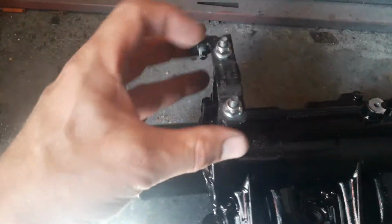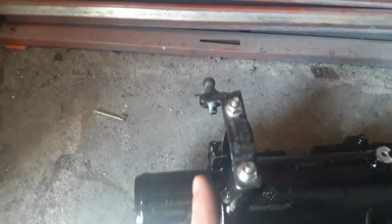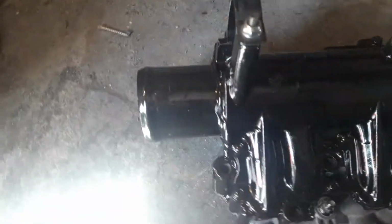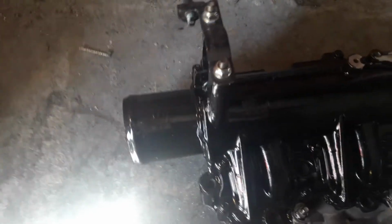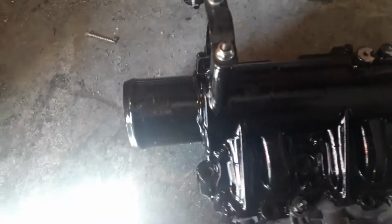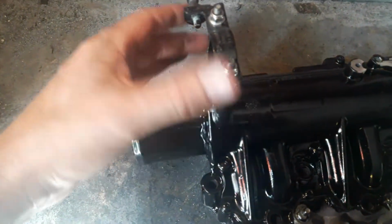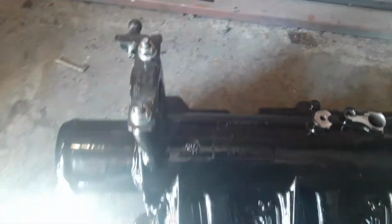On the back of here, you can see the manifold would normally have the EGR valve sat there. That's actually been literally cut straight off there, so you've got no issues with EGR being puked into the inlet manifold and creating the problem that we've just deflapped to get around. But part of the EGR valve does actually serve a purpose, as in it holds the engine cover on. So we've actually cleaned that bit up, refitted it just so that the engine cover is not flapping around, so that it's properly put on.